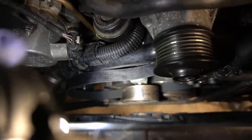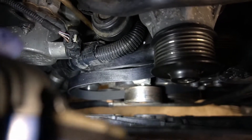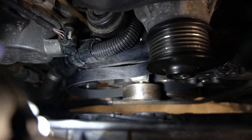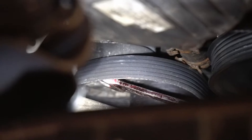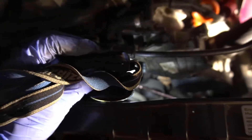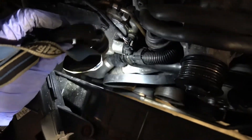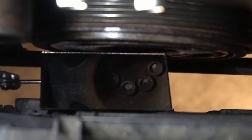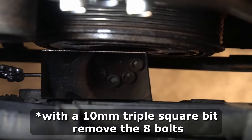You can see some thread on that idler pulley — I loosened it up a little so I can squeeze by the idler pulley for the supercharger and put the serpentine belt where it needs to go. Where that red wrench is, is where the tensioner is. I'm going to push down to relieve some tension so I can wrap the belt around the alternator. I used a paint marker to mark off the top of the pulley so the offset hole is easier to line up. This is my mirror setup so I can sort of see what's going on and line things up easier.